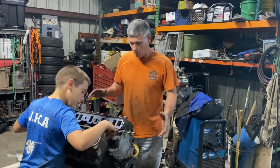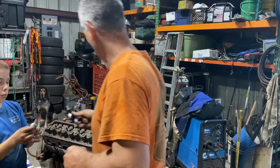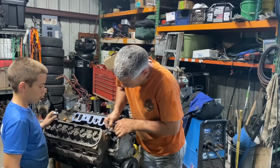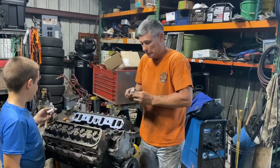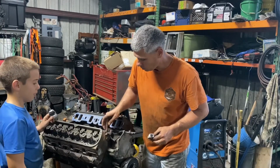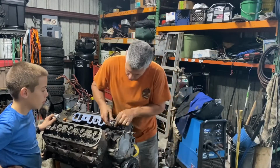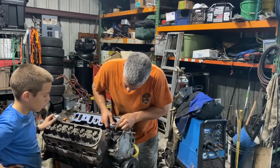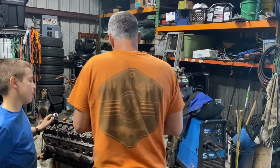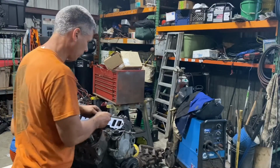That's what that's for. So then once you get the intake gaskets hooked on there, you take your RTV, your silicone, black and gray, and push it up on there. You squirt yourself a line across there. I don't have a lot, so I'm really having to be careful here. I use every little bit that I got. Spread it around. It doesn't take a lot of this, but you got to have enough to put a good 1/8 inch bead on it. Make sure you push it up into the gasket where there's a little notch. That notch is for the stupid cork gasket that never stays there.